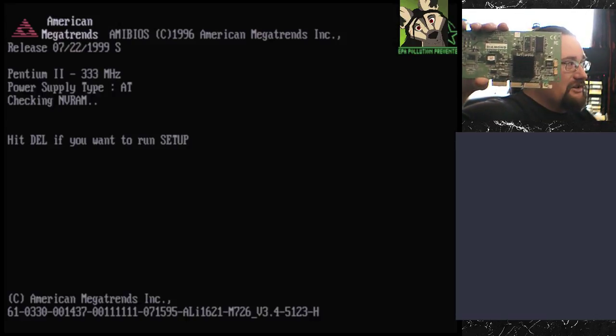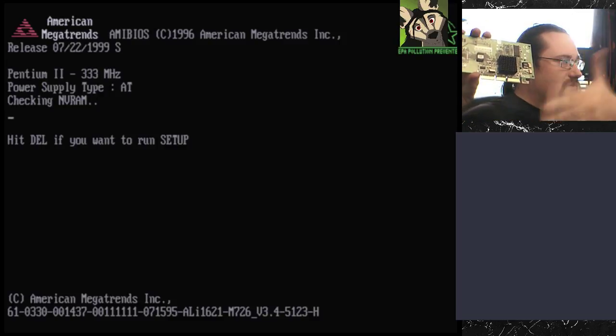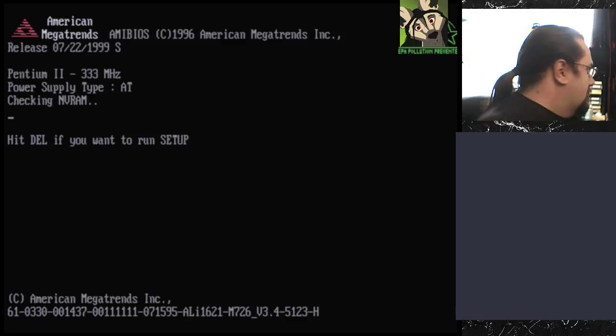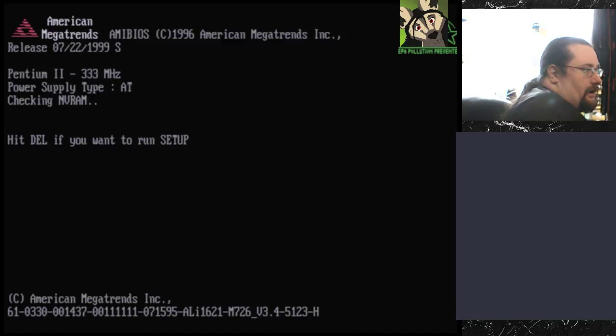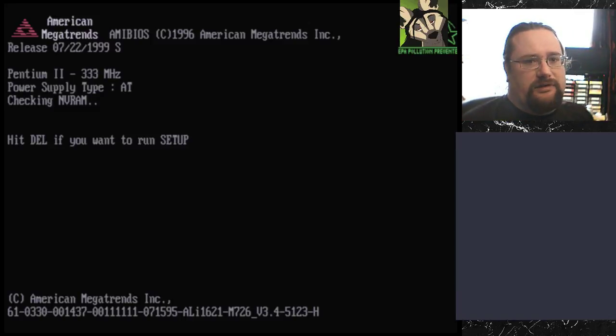Because this was a build, you don't sort of test everything. Let's see, where's that graphics card? So this graphics card, she's dead, Jim. I need to test that regulator probably or something. It doesn't work in this motherboard at all, so off with its head. Then the other thing is, I'm actually running the SATA adapter and the CD-ROM on primary IDE. Secondary IDE doesn't want to pick up an ATAPI compatibility. I've got no idea why.